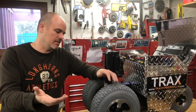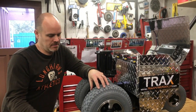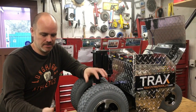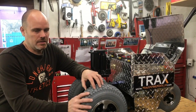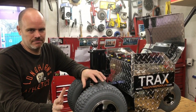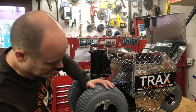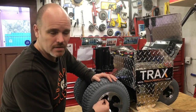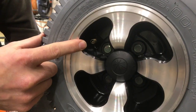Let's say hypothetically you're out moving a trailer around and you run over a nail. Your tire goes flat — well, if the tire is flat that's easy, but if the tire still has some air pressure in it, you need to undo the tire inflation cover and remove the valve stem in there.